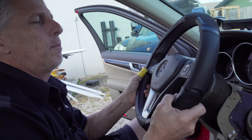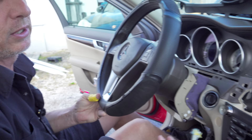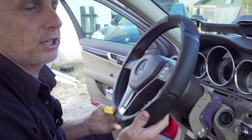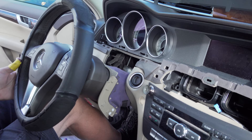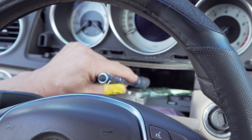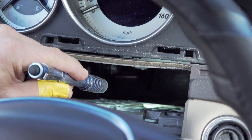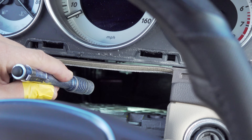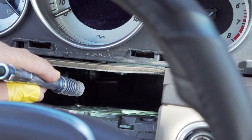Now the ignition switch doesn't move, but the column will move forward. Underneath, pull the column all the way out toward you and put it all the way in the up position, because the column is bolted to a frame with four bolts. I put in two long guide bolts in the bolts closest to you underneath the column to keep it in a relative position. Down in the hole is where the steering lock sits. I keep it bolted in to give it more rigidity so I can drill it out. We'll go to the bench and I'll show you where I drilled out this particular lock, then we'll move to the other vehicle with the more difficult electric column.